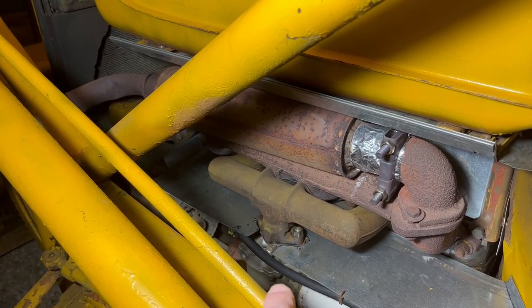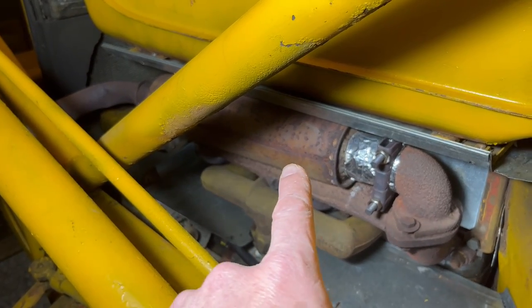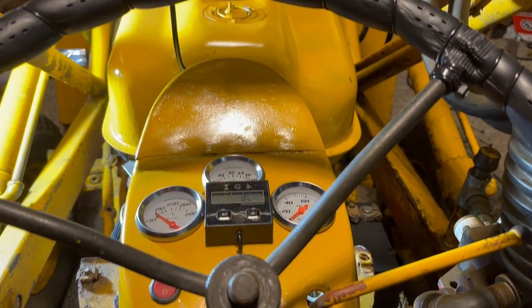Your gas line needs to stay under 140 degrees, but the radiator is blowing 200 and the exhaust system is radiating over 500. You'll be running along fine for about 10 minutes and then vapor lock will shut you down like a switch.